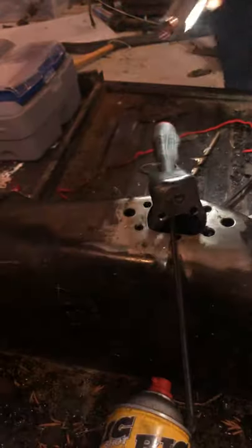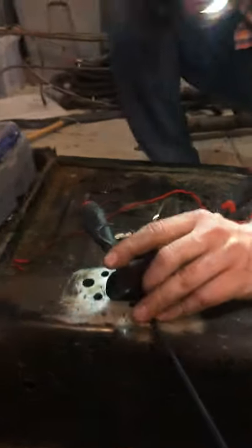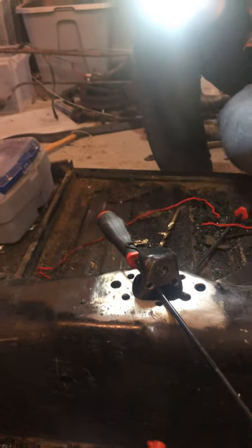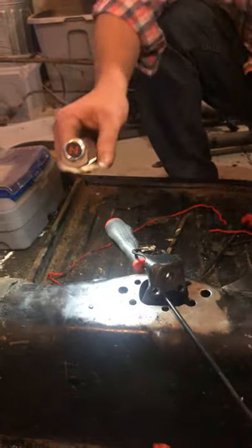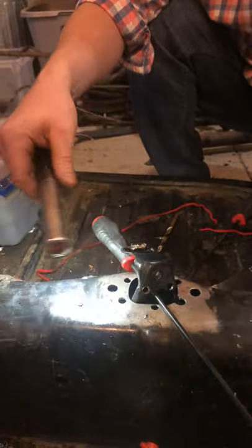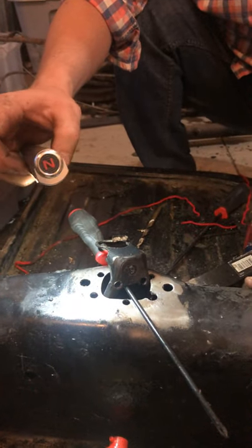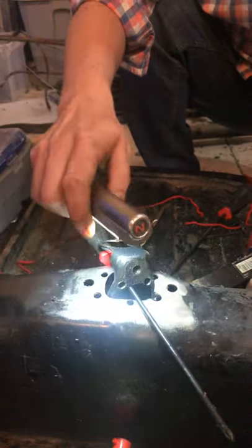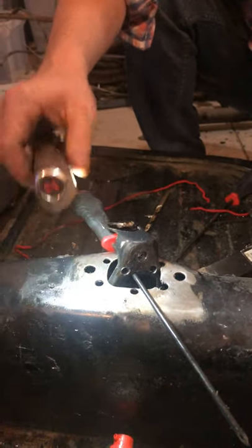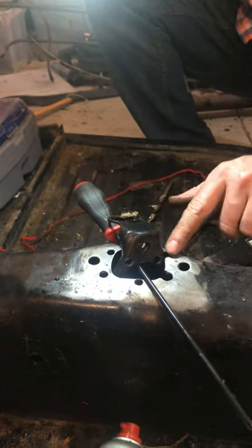I finally took the shifter off and lo and behold the hanger bracket is broken. Looking around, I saw lots of videos on how to replace the bushing but none on how to actually replace this bracket, so that's what I'm doing. I saw a lot of people say to cut the top of the tunnel off, then drill it out and reweld it. Others said to drill the welds out and it will pull out — but it does not pull out of the little tiny hole. To find the weld spots you have to take the paint off the tunnel, and there are six of them.